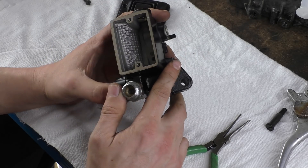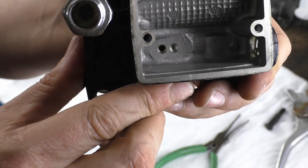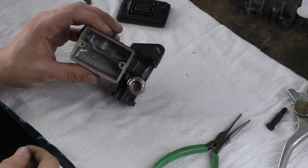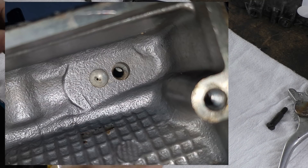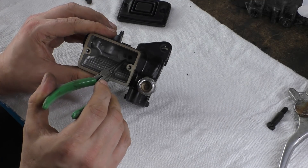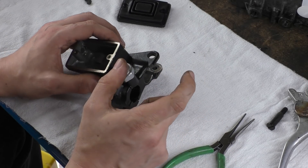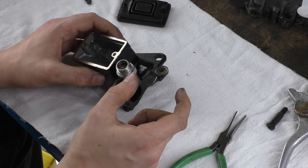On the inside you'll see two holes in the bottom. From a picture you can see there's a big orifice — a big hole on the front — and then there's a little tiny hole with a chamfered edge on the other side. Basically the bigger one is your inlet port, and the little tiny port is what you call your compensating port. The compensating port basically makes up for the fact that your brake pads are contracting over time as they wear.